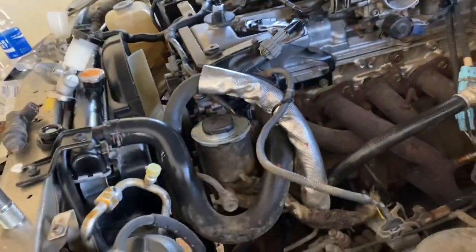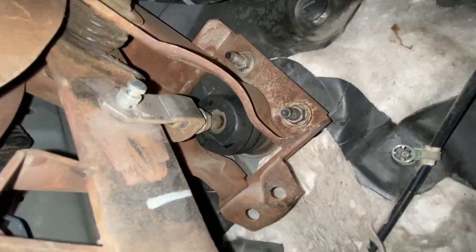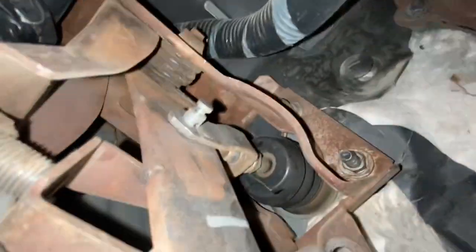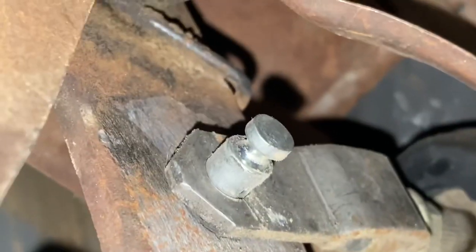Now go ahead and replace the booster. Get the old one uninstalled. So that basically is just one pin that goes through the clutch pedal and then four nuts on the inside. And we should be able to, hopefully there's enough space, get this out of this gap. I removed these plastics, and here we have our backing plate for the clutch booster. So those are four 12 millimeter bolts on each side, and then there's a pin that sticks through that, which I just pulled out and it dropped somewhere.